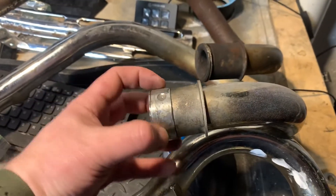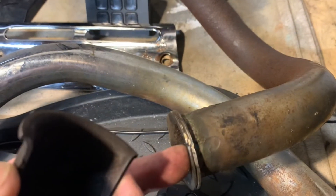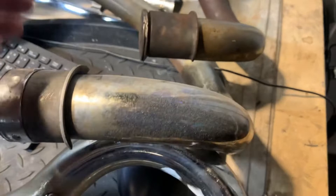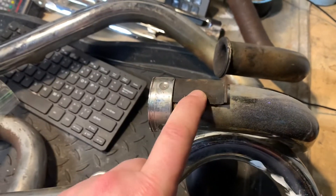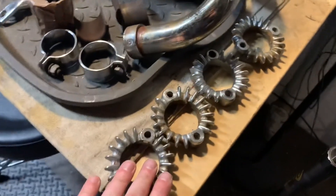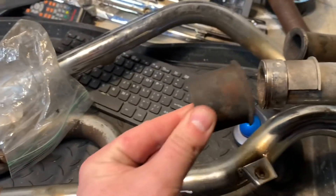These pipes have a thicker end and they need that shorter flange, while the old style — the '68 to '70 style — is going to need these longer ones. And these longer ones are a real booger. The problem I had was that I went to put my pipes onto my 1970 CB, and there was no way they were going to go because I didn't know about the huge difference in the length of these different flanges. There's really no difference from what I've seen with the main pipe pieces — it all really comes down to the thickness of the end and the length of these flanges.